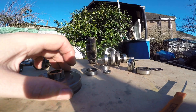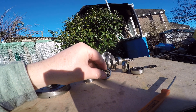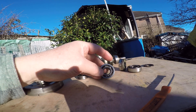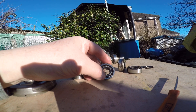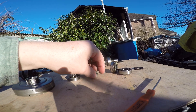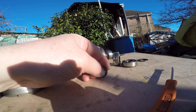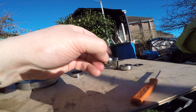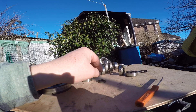On the left-hand end, there's a slightly different arrangement. You have your bearing — that's the outer surface — and you can see dirt on there. But this bearing is actually in relatively good condition, although it's got dirt and grit in it. You can see that all the balls in their plastic cage are actually fairly shiny, so you might just about be able to clean this one up. The oil seal sits outboard with its two lips and the garter spring, which backs up the inner sealing lip. This one has actually got a crack. So these are consumables — they need to be replaced each time you rebuild a bottom end.